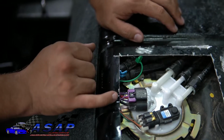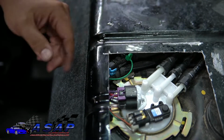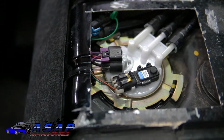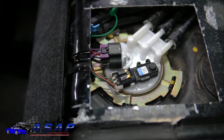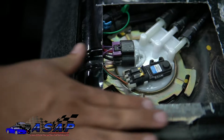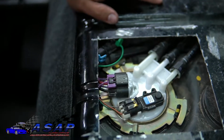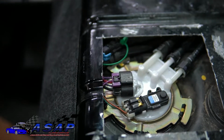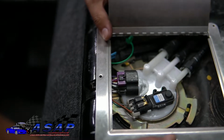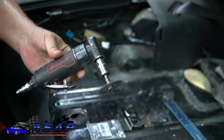This one's a little bit more fun to cut because you've got the recess there, but it's not terrible. Like I said, have a shop vac handy so you can go in here, because it is going to make a mess no matter which way you do it. In my case here, I had some of this body filler stuff, seam sealer, that they had glooped up here pretty good, so I took that down to where it'll sit nice and flush. And then, with the measurements I gave you guys a little bit ago, it sits in there all nice and easy.